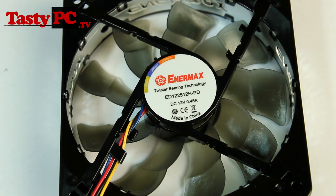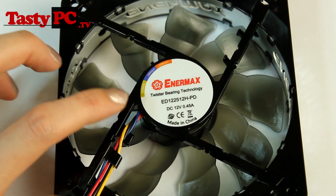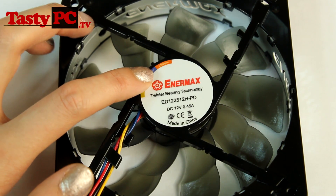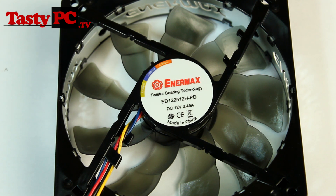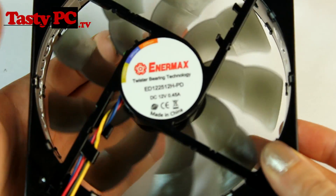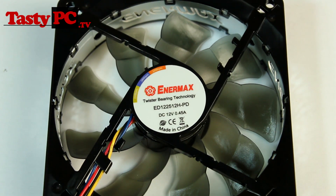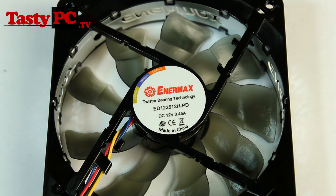One of the features highlighted on the box is that these fans have three cooling modes, controlled by a little switch on the fan. The three modes are 1500 RPM which is silent mode, 1800 RPM which is performance mode, and 2200 RPM which is overclocked mode. I'm really impressed with the concept of selecting your RPM directly on the fan, but I do think it has a major flaw. Because of the way the fan is fitted to a radiator, once it's installed it's nearly impossible to reach through the blades to the switch — and it'll be even harder on the sandwiched fan of the ELC120. To switch from silent to overclock mode you'd have to remove the fan entirely, which is a huge inconvenience. I think most people will just keep it on the highest setting and use fan controllers or low noise adapters instead.